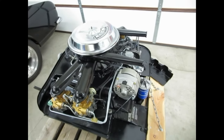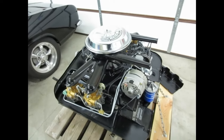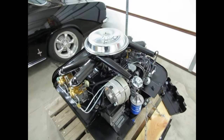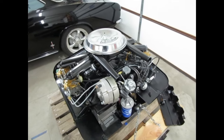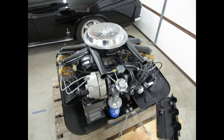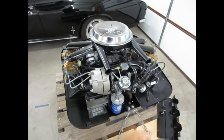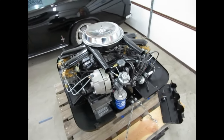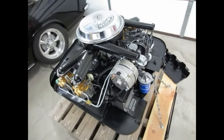Some people say, well, why don't you just go ahead and change all the seats? That way you'll know. Well, that isn't necessarily the case. I've been testing a lot of heads. I had a cylinder head, a 95 horse head, that had deep seats in one cylinder. I heated it up to 450, and the deep seats fell out, and the standard factory seats were still in there nice and tight. So changing valve seats doesn't mean they're not going to fall out. They could still fall out, or it depends on the type of workmanship that was used to install them.